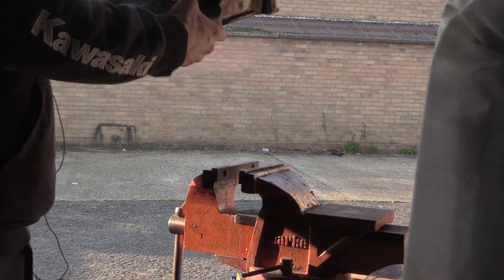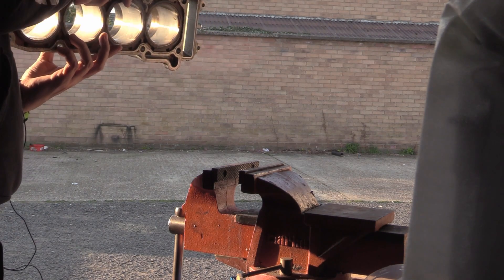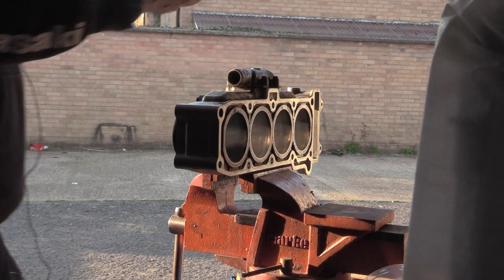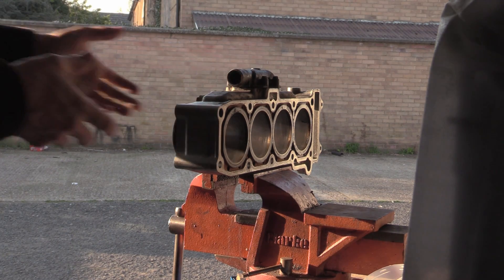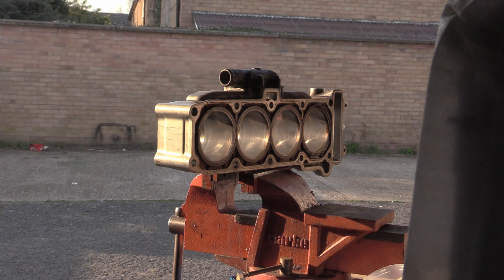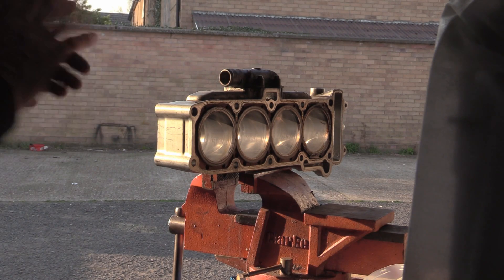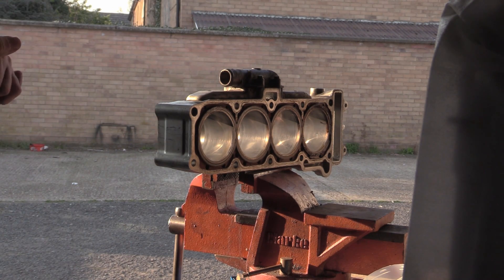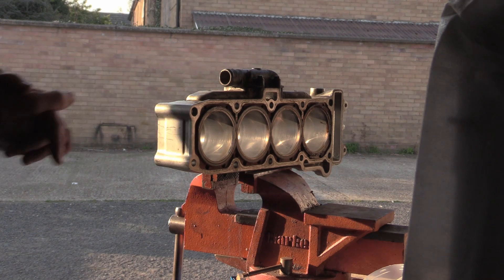There's a mark — the same repeating mark all the way down the bores, unless that's a pencil mark. I just had to show you this in natural light — you really do need natural light, you'll see so much more. Holding it up to the sky is all good, I just can't do that with a camera tripod. Are these bores done — will they need stripping, boring, replating? Yeah, they'll need the works. If we're going to recover that engine and bring it back to life, it will need the works.